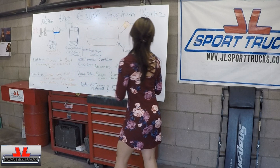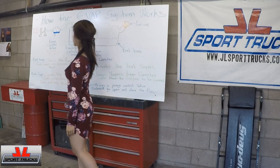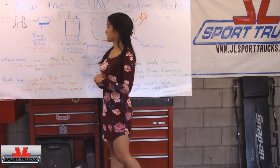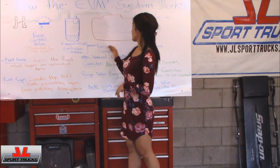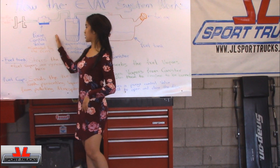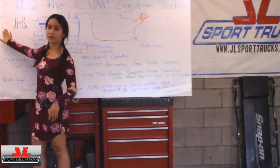The parts we're going to be using are the fuel cap, fuel tank, and the canister. To be more specific, it could also be called the evaporative emissions canister, but it could also be called two other names: the fuel vapor canister or the charcoal canister. Next is the purge control valve, which is controlled by the ECM, and last is the throttle body.